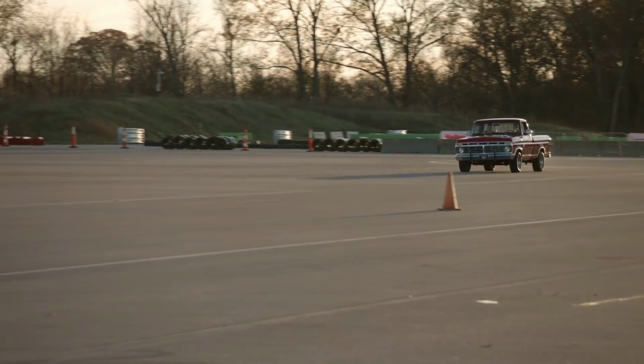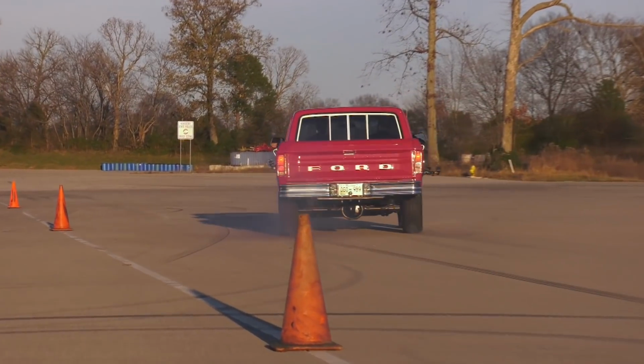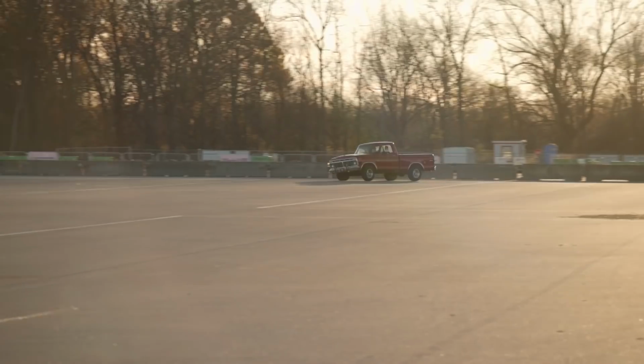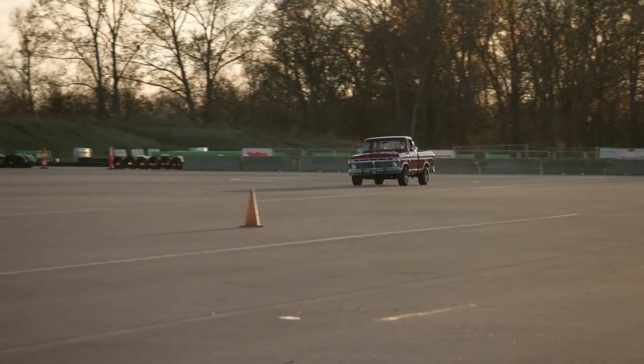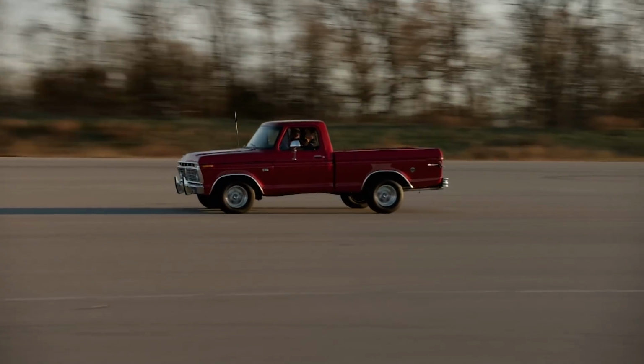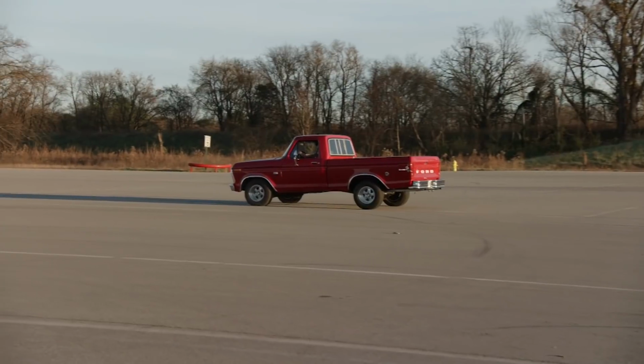With the acceleration figured out, next we'll see how well this truck stops. Now, you know we have to measure that in a straight line, not a curve, right? I like going crooked. That was 100 feet, but we're at 45 miles an hour. We'll back her up just a little bit further this time and see if we can get up to the full 60 miles an hour and give it another shot. Not bad. So we got 11 seconds to 60, and it took 150 feet to stop from 60 to 0. So it doesn't go and it doesn't stop. Basically.